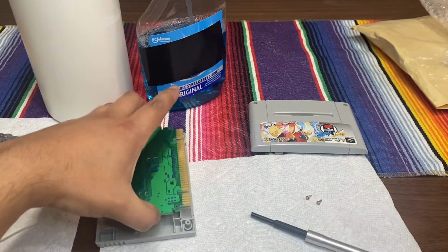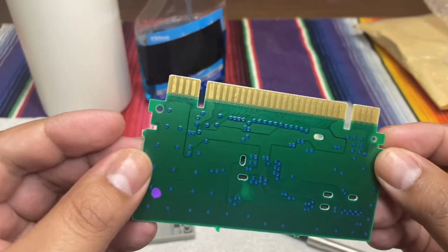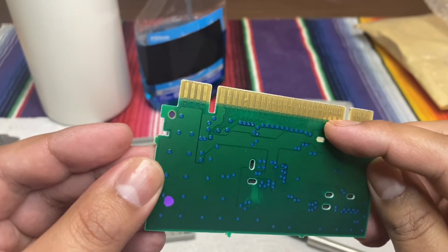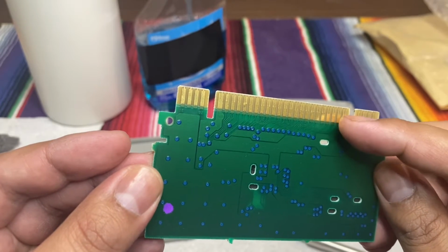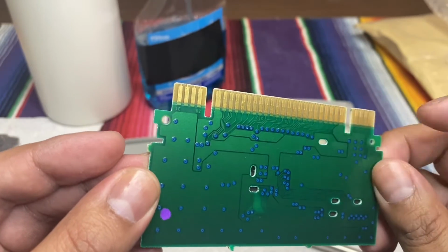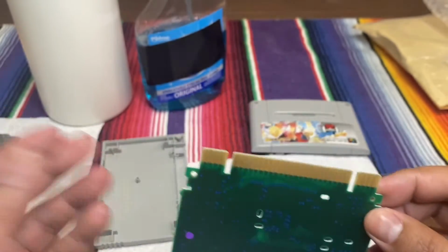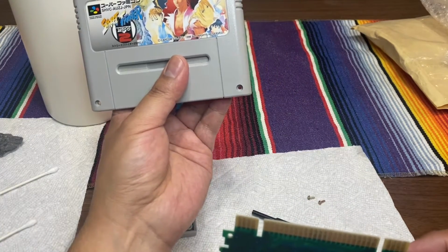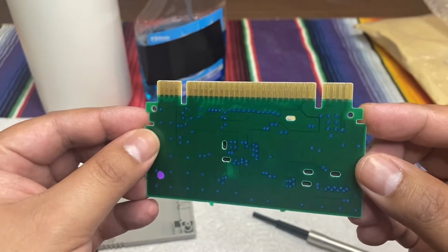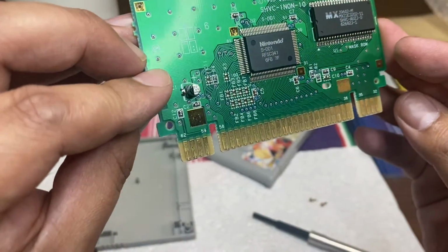So here's the main focus, what you will see in every game. You can't really see if it actually picks it up. You're going to see the pins right here, the layer that is underneath the cartridge, so that's what's inside, so it looks cleaner. You have that top layer, it looks like a straight line, and that's pretty much all the oxidation. That's just from playing a game for this much time. This one actually did release in '96, so imagine that, and people just blowing in them. I guess the way we were taught, for some odd reason, to fix cartridges to play them, I think you have a better shot there.